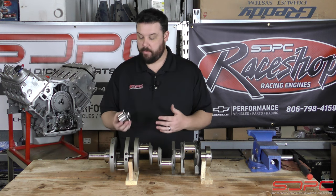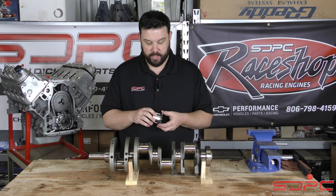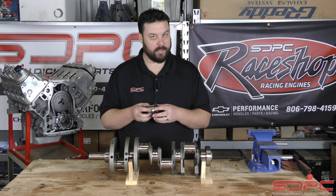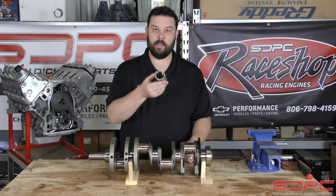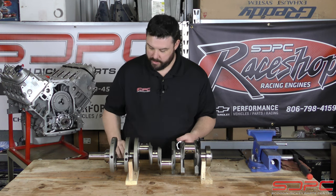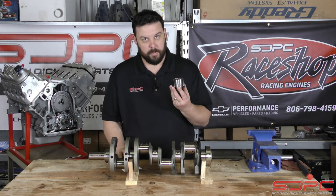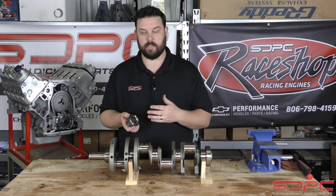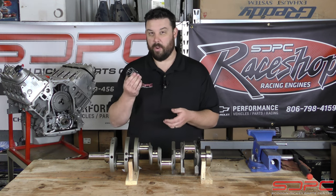Now if you are wanting to run one of the OEM-style single chains on your LT build and you have an aftermarket crank, what I've been holding in my hand here is actually a product from our good friends at Texas Speed and Performance. This does have the extra chamfer machined into the back of it. It's the same hardened billet steel that the OEM uses, and they even have a couple of extra keyways ground into it so you can advance and retard your timing. They even include a small illustration to help you while putting it together. We keep these in stock — it's a pretty cheap little piece if you're still running the stock upper timing gear and/or VVT gear and a stock-style single chain with an aftermarket crankshaft. So if you need one, make sure to give us a ring so we can save you from wrecking an engine.